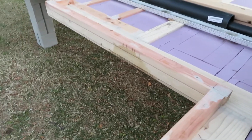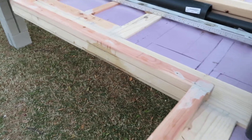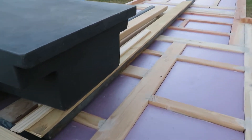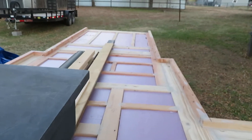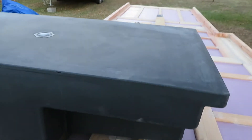I will also coat or place something down between the water tank and that — in case some of you didn't know, the water tank will gradually settle, and if you have foam rising above it, it will actually put creases in your water tank because the foam is going to give out faster than the wood. Whatever shape those might be in, it would actually drop the tank, and I don't want that.